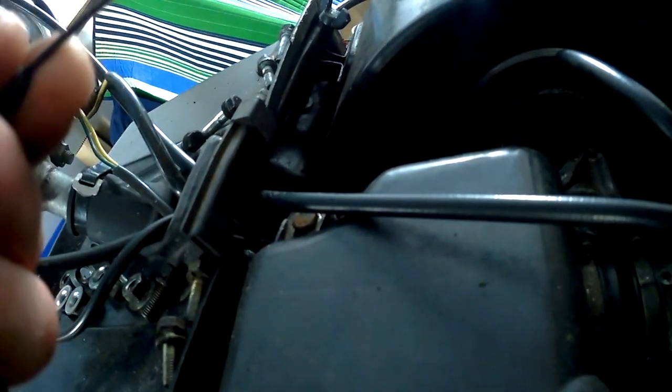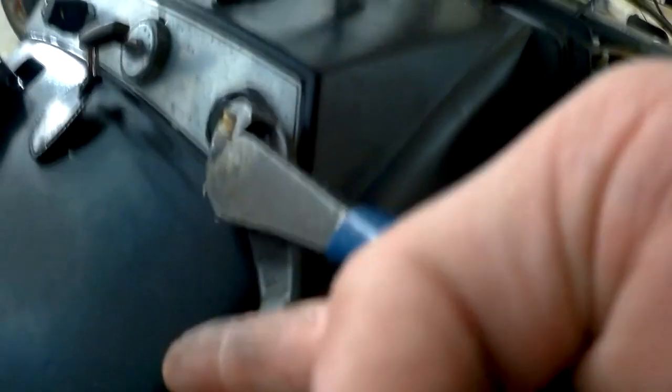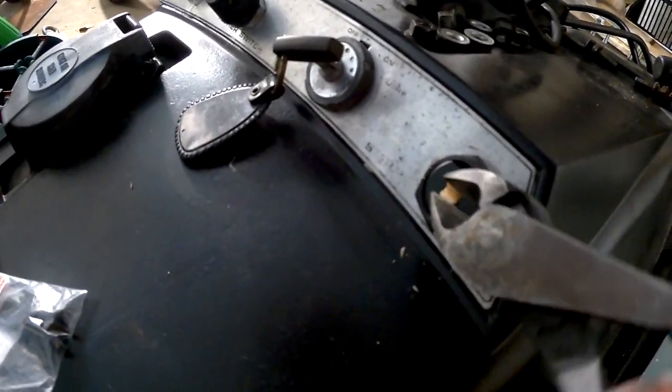Pull your spring back so you have slack on your cable, and you can pull off your choke. Your cable might want to come off here — that's fine. It gives each cable slack to go upwards. Once you pull that off, set it aside. Then take some side cutters or something, grab the cable end — there's no tension since there's no spring on the end now. This one's kind of way down in, being a bit of a pain, but there we go — pull that up.